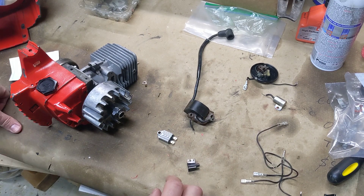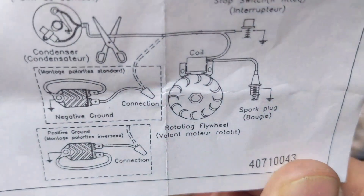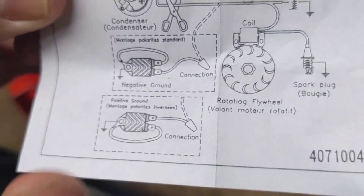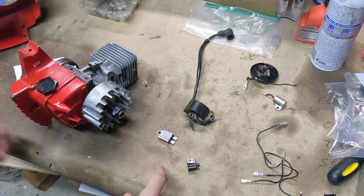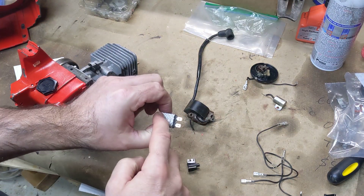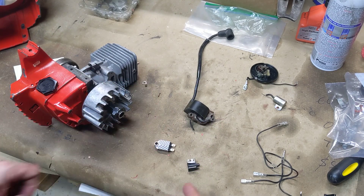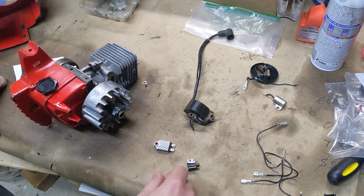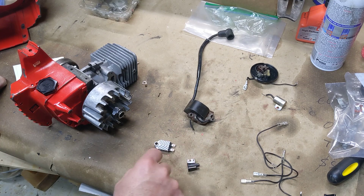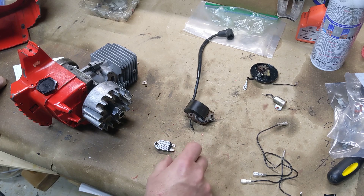The way we're going to hook it up — in the little diagram here there are only two ways to do it: one's a positive ground, one's a negative ground. All it means is one of these legs is grounded and the other one is going to go to the coil and some other things. Most of the time it's negative grounded, so we're going to go with that. If you get it backwards, you can just flip those and try it the other way — whichever way you get spark.